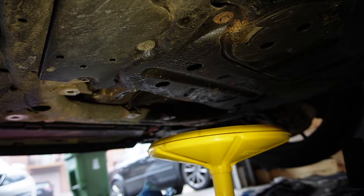Now that we're done draining about 99% of the old fluid, I bought two 500ml bottles, making 1 liter total, and the front diff only takes about 600ml. Since I have more fluid than needed, I'm going to run a bit of new fluid through to flush the system better — about 50ml or so should be enough for that.